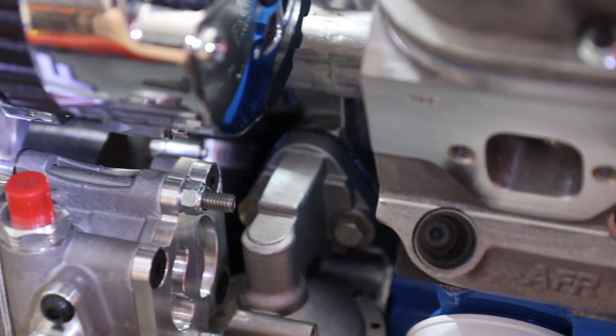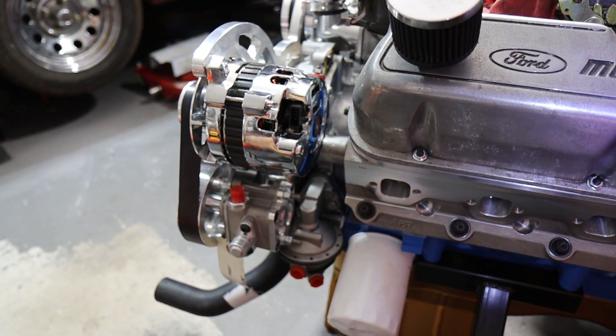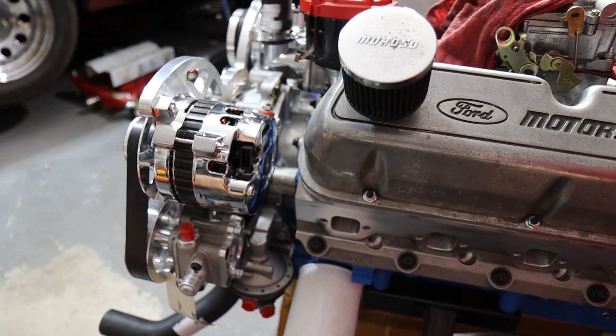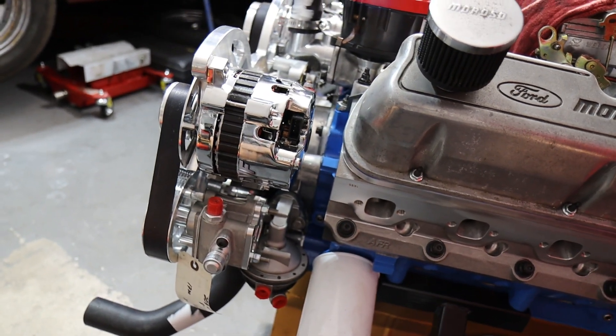There's my timing mark right there — right in the center. You can see the hash marks; it is right on top dead center. The point is I can see that mark from way back here. It's a small hole and you've got to be looking at it at the correct angle, but I can see my timing mark with this kit installed, and I've already checked the angle from the car — I can easily see it standing next to the car and looking over the fender. So I'll be able to set my timing easily using the marks already etched into the ATI super damper without changing anything about the basic configuration of this 289 engine.